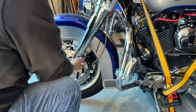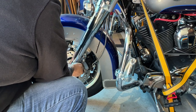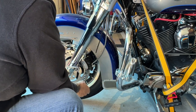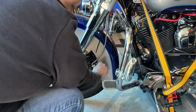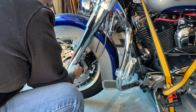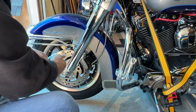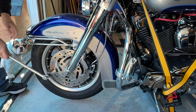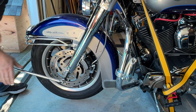I'm going to bring it down as low as I can go — it looks like it's going to bump the fender no matter what. I'm going to leave that one caliper on just one bolt so that it doesn't slam. When I let the wheel down I'll watch the other side because that caliper is just hanging over there and I don't want to chip my fender. Now let's get this axle nut off. Don't loosen up those two pinch bolts on this side, because then the axle nut will just spin on the other side.